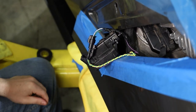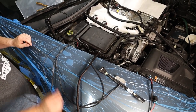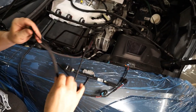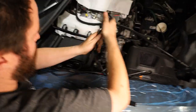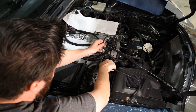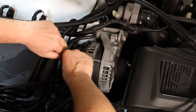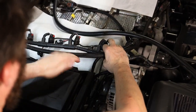At this point, plug the ECU back in underneath, put the fender back together, and get into wiring the top part of the system to the injectors. We're mostly wrapped up underneath the vehicle now. On the top side, JT is going to grab the injector harness and run it over to the top of the vehicle. He'll feed the harnesses up through the front so they drop in and run down either side of the engine, sitting by the coil packs for now.